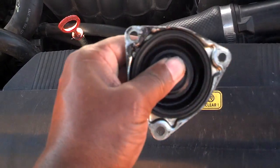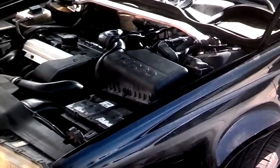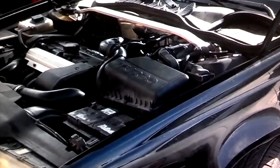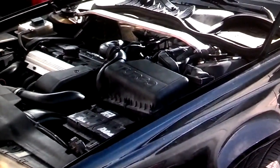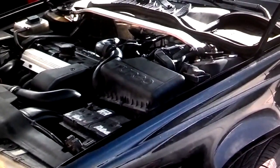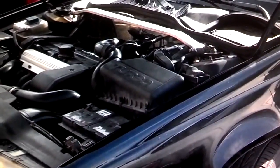It's a little bit hard to access, so I'm going to take a few parts off to get at it. In this video, I'm going to be replacing my bypass valve that's mounted on the front of my turbo. I'll pull off my intake tubing, remove my air intake box that my air filter's in, remove the turbo pressure supply that goes over the top of the motor. Then I'm going to use a 10mm socket and box-end wrench to slowly remove that bypass valve cover so that I can access and swap out the bypass valve.